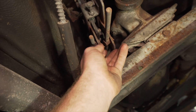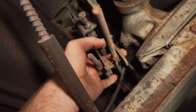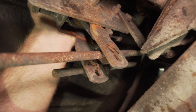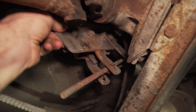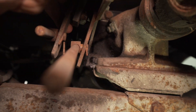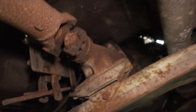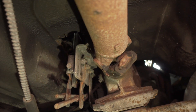So I did a little research and you need to get the transmission to neutral first, then adjust the linkages so the shifter can go back and forth between the two brackets — that's neutral. There might be something wrong with that pin too; the pin wants to be pushed out. This bracket definitely needs to be braced — it's just flopping around. I might need to make something that goes from here across to the top of the transmission. That slotted mount down there isn't helping either — it's just moving around.